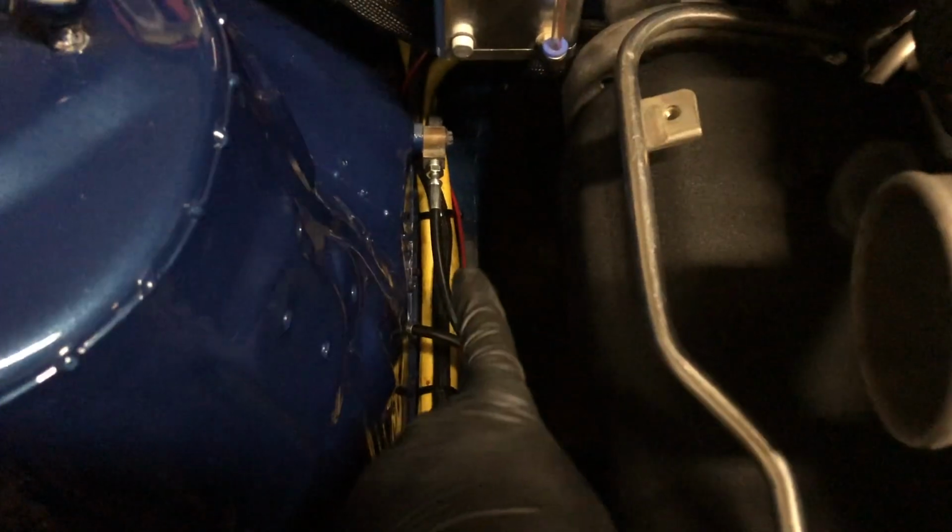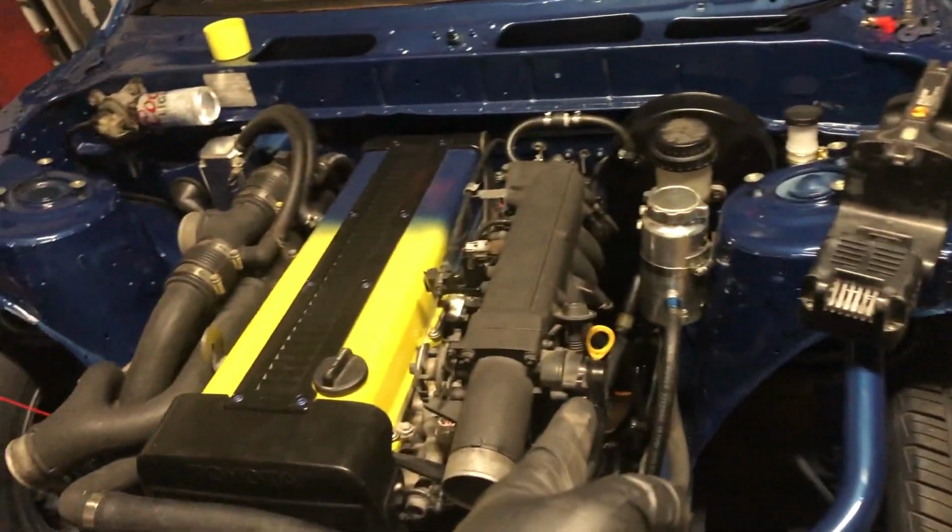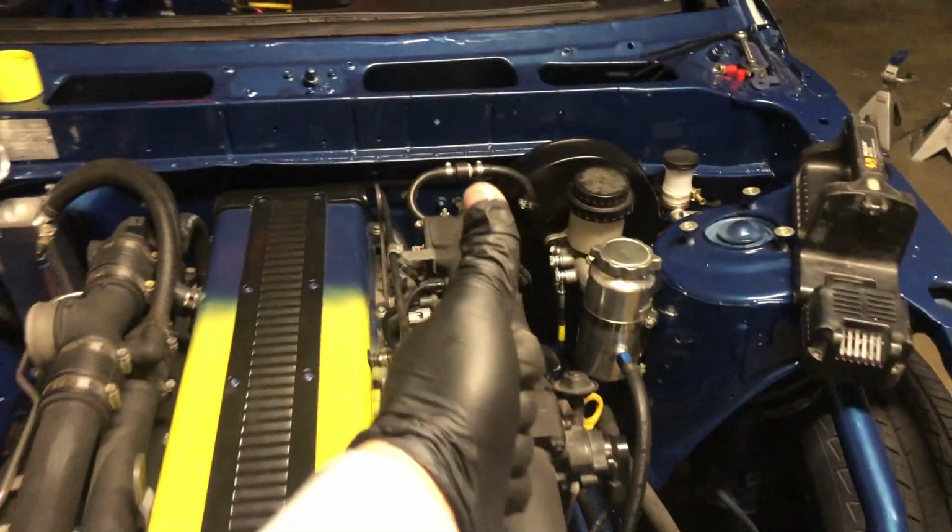So I got it put into the block there. I got it put into the brake thing over there. And what are you gonna say? Yeah, it's ran across the subframe. Not how I would want to do it, but it's still cleaner than the factory lines. And then we got all 3 banjo bolts here, all nice and tightened up. One goes straight down there. You can't really see it, but it goes directly down into there. And the other 2 across the subframe. So that being said, our Chase Bays brake line relocation kit is installed.